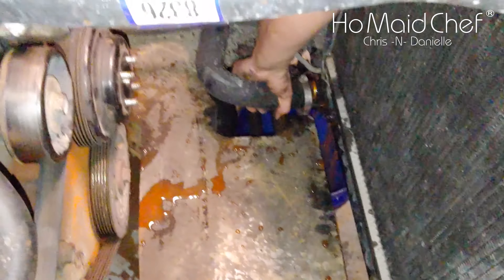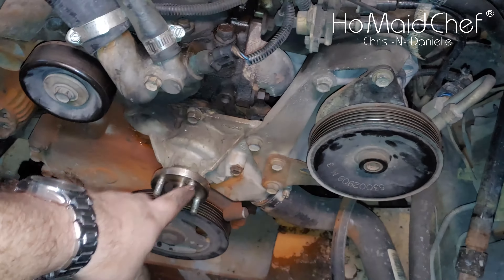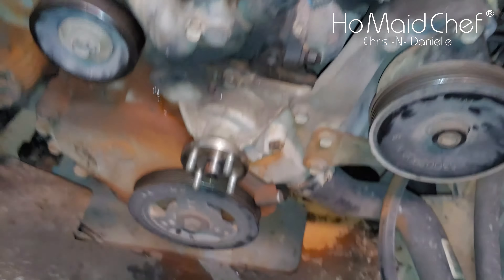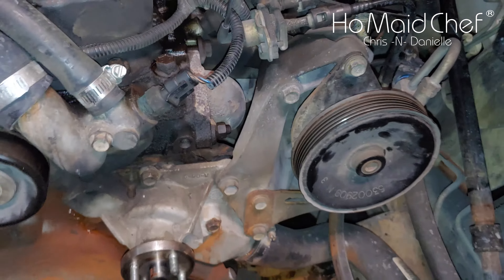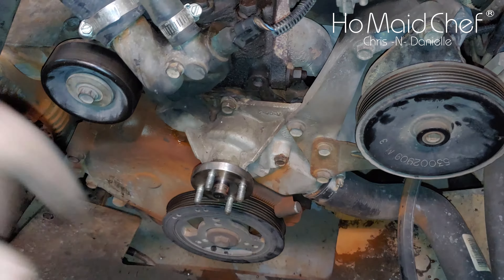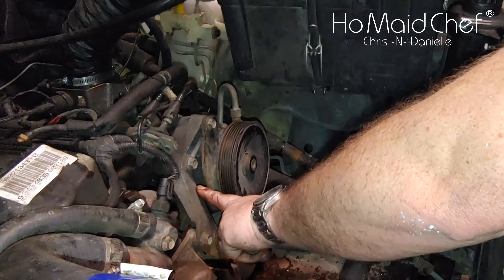We got most of the water — the majority of it's probably on the floor, what a mess. We got the belt off and the pulley just fell off, but I'm not feeling any play in it. Normally to take off the belt there's a tensioner on your power steering pump on the driver's side. Now we're going to get to taking this off so we can get to the pump which is behind all this. We have to take the power steering pump off and the bracket mount that holds it.